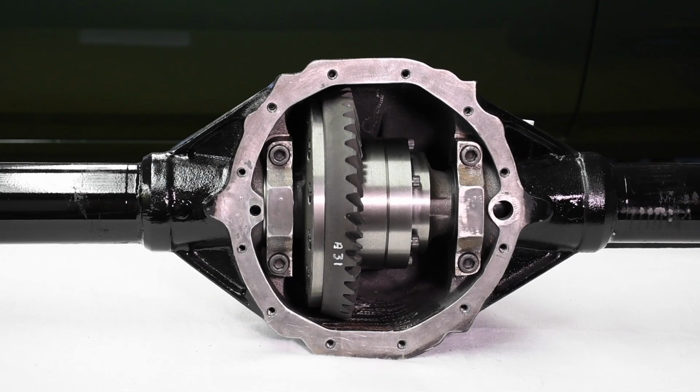Mark Williams can supply a rear end with a conventional 30 spline or 33 spline axle, or if you need brute strength, it can be manufactured such as this one. It accommodates a honking 35 spline axle. We'll address axles later, but the bore size of the case determines the axles you can use. When the axle spline is increased, the diameter of the axle shaft increases, and that's what dictates the need for a special large bore case. The 35 spline axle is huge. Think Dana 60 huge.